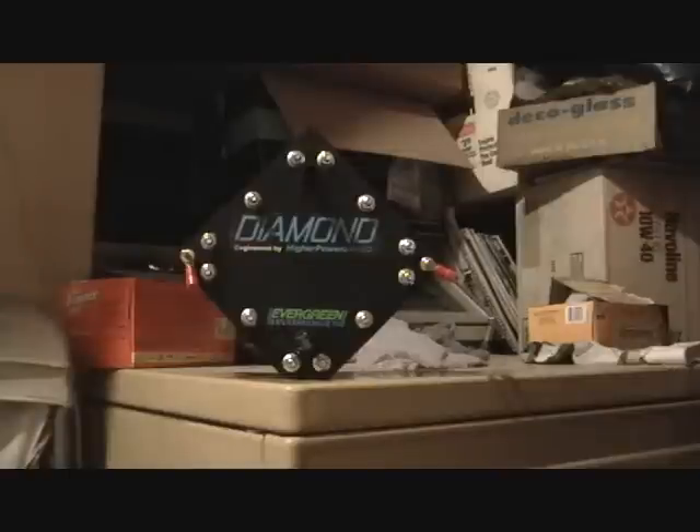One step at a time — got to get the Suburban set up. It turns out my Suburban was only a 65 amp alternator and I was running the cell at 50 amps, which slowly killed my battery. So it's time to step up to the big alternator, dual batteries, and there will be an isolation circuit. Also, each cell will be on a voltage sensing circuit — if for some reason system voltage goes below 13 volts, it will kill one cell at a time to make sure I don't get stranded. That circuit will be available online for you to build, and also available to purchase.